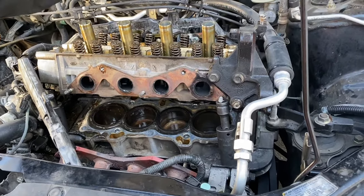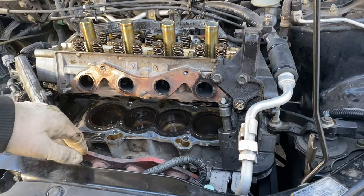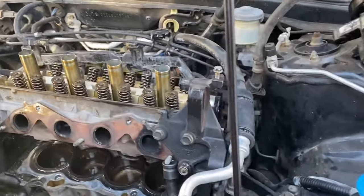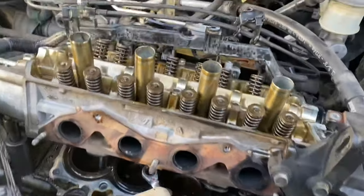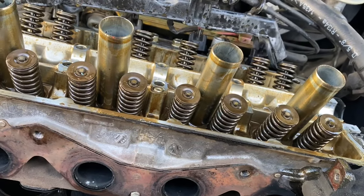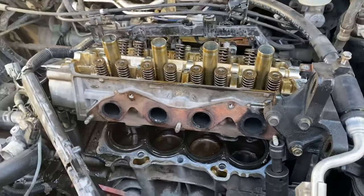Anyway, now we're gonna get the final one. It's actually a nut on the intake. It's right in the middle. Make sure it's the middle one, not anything on the side. It's directly behind this stud. The best way to do it is after the head is propped up. We use a gear wrench to go in there, reach behind, and you'll be able to feel the middle one. There are three back there you can feel, but you want the middle one to come off.